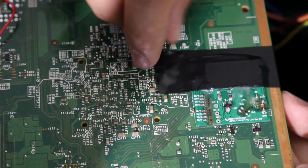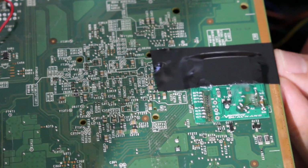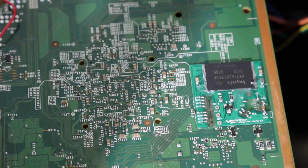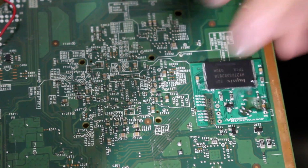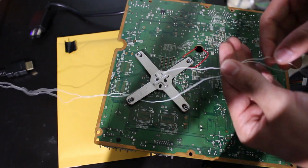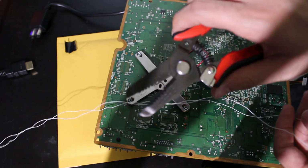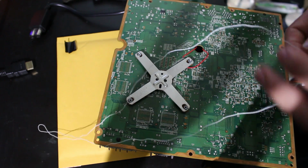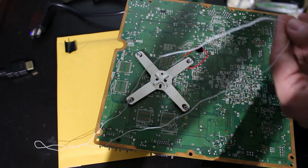Well, one, because of the convenience factor. That way, as I said, I now have a pretty looking slim system which has a regular NAND which I can get onto Xbox Live safely with and do whatever I want to on there, and it has a hacked modified RGH NAND, and all I have to do is just hold down the sync button for a second, it flips over, and then I can turn it on. I don't have to do anything else. I don't have to swap out systems. It's a nice thing to have.